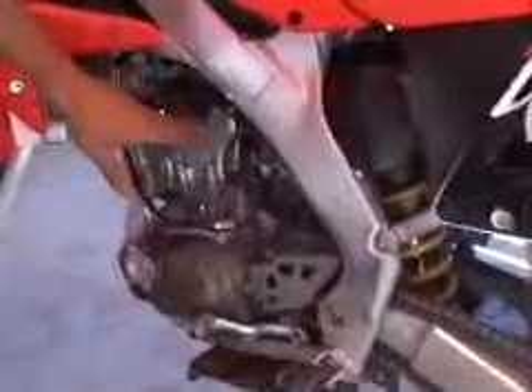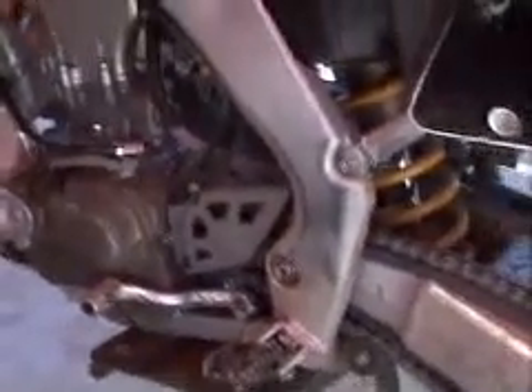What we did with our bike this year, we changed the cylinder head. We changed the intake and exhaust ports, reshaped them for more velocity, smaller volume, more bottom, mid-power, and changed the cam ignition timing to go with that.